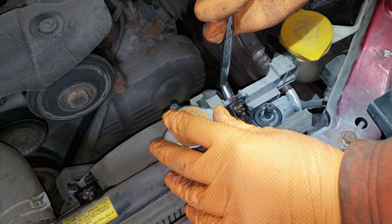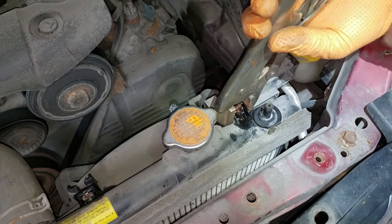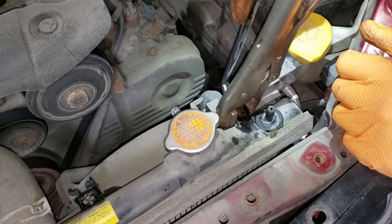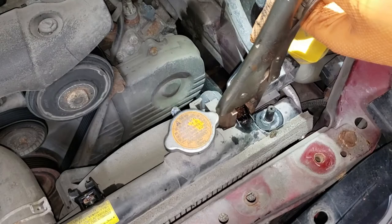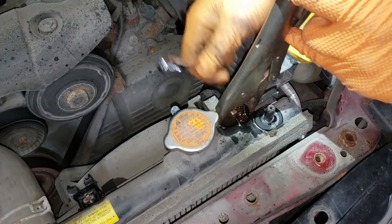You can see the plastic is working back and forth so it's going to crack. Here's a perfect example of what you do with your vice grip — grab it and clamp it as tightly as possible without breaking the radiator. If our new radiator hasn't come with new inserts, we're going to end up tapping and reusing these. So you also don't want to give yourself more work by breaking the bolt off. Just go back and forth and give it a little bit, following the same process until you get the bolt completely out. If need be, hit it with some more WD-40.